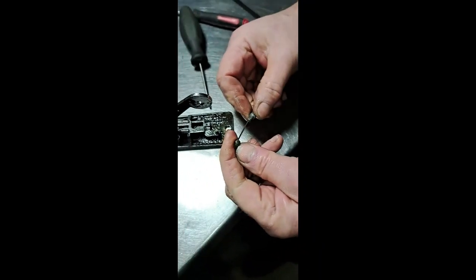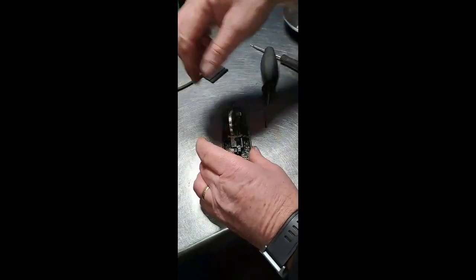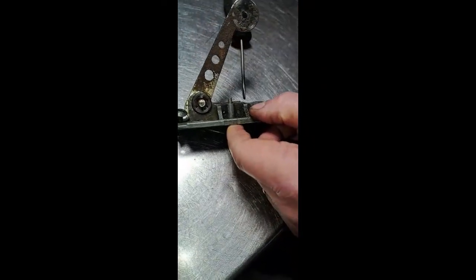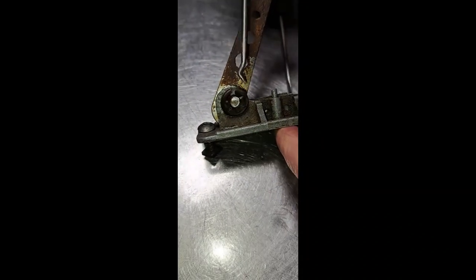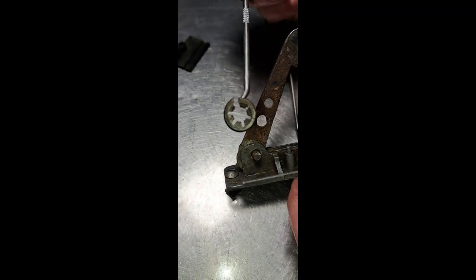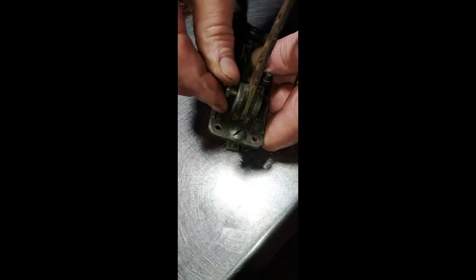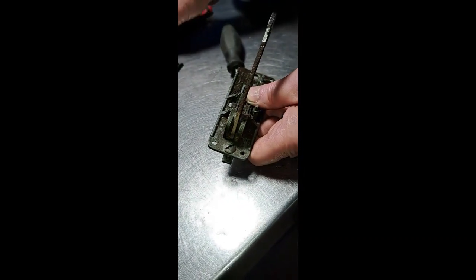The cable line — everything's good. Now once we've got this out of the way, we need to think about changing gear. On this side here you can see there's a locking ring — we're just going to take this off. I have had this one off before and as you can see it's slightly broken because it was so seized, but that's okay because I've got some new ones waiting to go on. All we need to do now is pull that pin out.